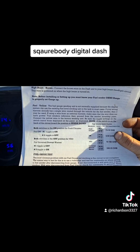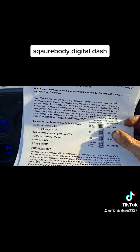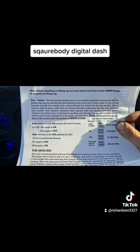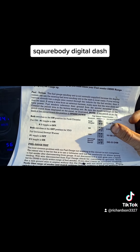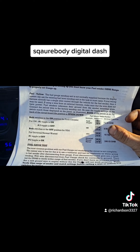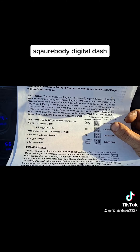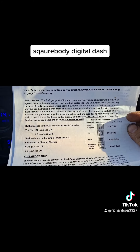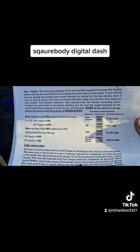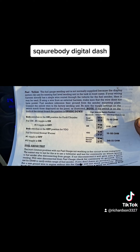On the fuel, it's got a list of everything in the instructions. I went straight to the GM one because I've done this before. You can see the switches are not colored and it doesn't really specify which one is up or down. I looked at it and thought white was up, so I had it reversed. I had toggle one off and toggle two on when it was supposed to be the other way around. But I got it figured out.